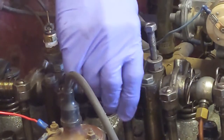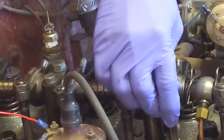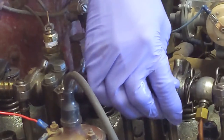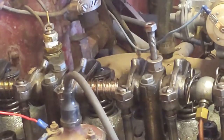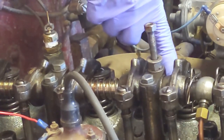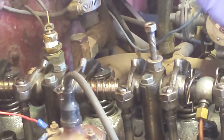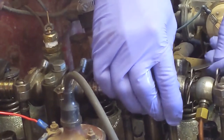This is the number four cylinder. This one's the exhaust valve over here, and this one's the intake valve over here. I want to measure the clearances — the valves are both closed and the rocker arms are just a little bit loose, so I can measure the clearances. Intake should be .008, and that's too loose.